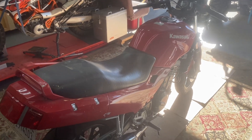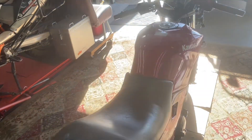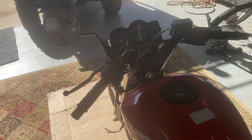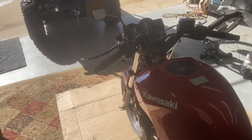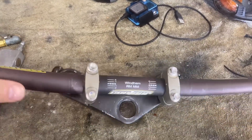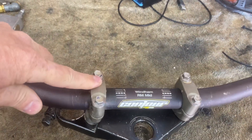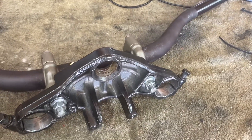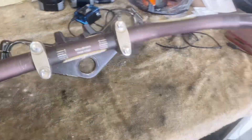I have a plethora of parts still up in my rafters for these. The first thing I wanted to address to turn this into an off-road type bike — and when I say off-road I mean mostly dirt roads, not single-track — is these clip-on style bars. In my stash of parts I had another upper triple clamp, and I've already modified this one: I drilled it out and put handlebar risers in it, then bolted those through with bars from my parts stash. That's the first thing I'm going to do.